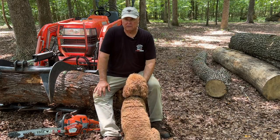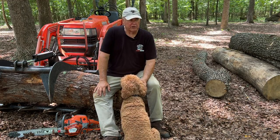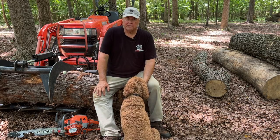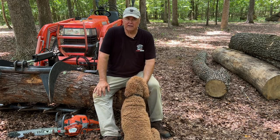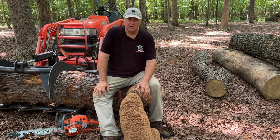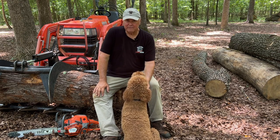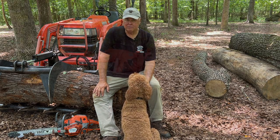So today what I'm going to do is a little test. We're going to run the 550XP Mark II with the original 325 chain, and we're going to do 3 timed cuts. And then I'm going to show you what you need to do to switch it over to 3/8 pitch. I'll show you the parts you need. We'll actually go through the changeover, and then we'll do 3 timed cuts with the 3/8 050 chain and compare, see if one's faster than the other, see if one pulls better than the other, see if one just generally feels and cuts better than the other. So that's the plan. So hang around, and we're going to crank up the 550XP with the original 0.325 chain on it, 20-inch bar, and see how it does.